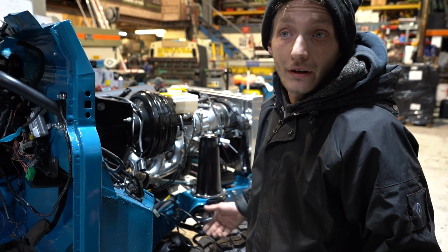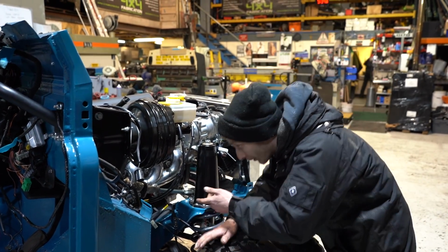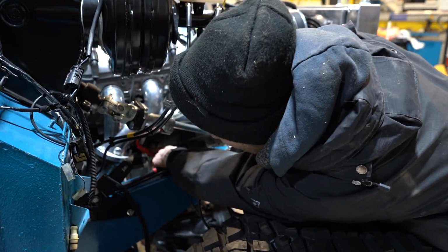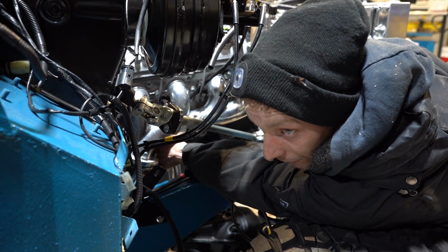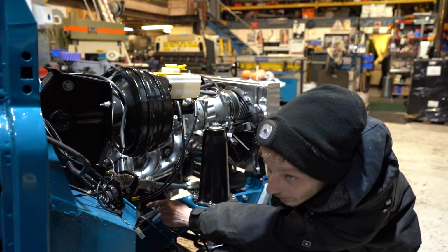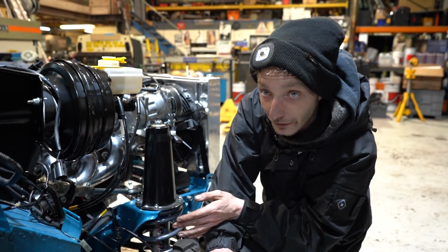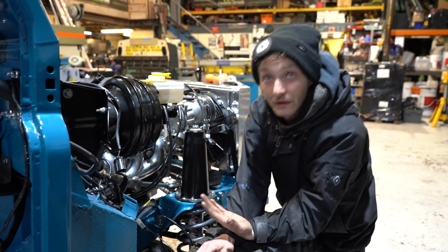The starter motor itself is a very high current device. So we've got the power supply here, the main power feed to the starter motor here, you can see with the red heat shrink on it. There's going to be a nice cover to go over here to protect it from the heat from the exhaust. So we have to be mindful that when we make the cables and we crimp the connections on, we make sure that it's got the right angle, that it's not straining the cable, but we're leaving enough room for the guard, because it is important to have a guard around your wires.